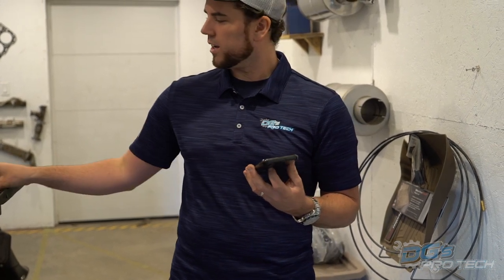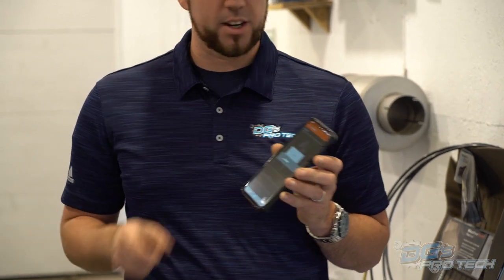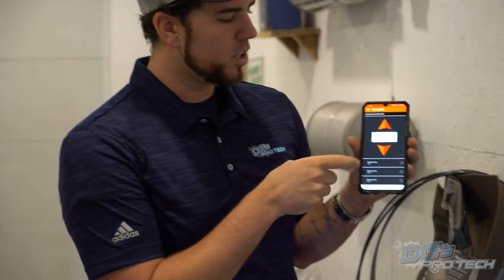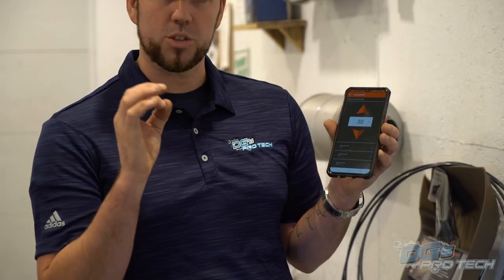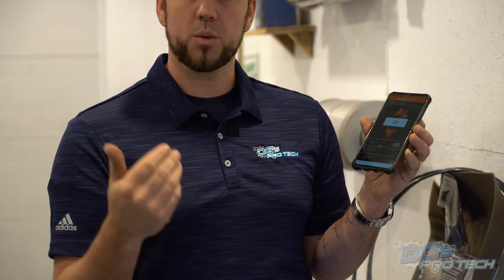They've also got a new app with the Wireless One system. If you've got a system that uses the wireless controller - which is meant to clip on your visor - you also have the ability to download their app on your phone. This is now your controller. You can go up and down, control set points, and have pressures preset - maybe 5 PSI for empty, maybe 40 PSI for your gooseneck or RV. Everybody loves connectivity and apps.